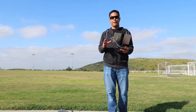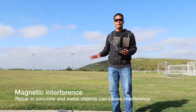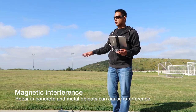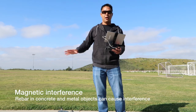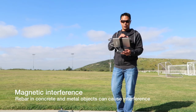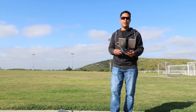If you're having trouble calibrating your compass on your Mavic, you might have magnetic interference nearby, or it may just have been a bad calibration attempt. Move to a different location — it could be in a grass area or another part of the sidewalk. Once it's calibrated, you'll see the green flashing lights and the app will show it's ready to go in GPS mode. That means you're all ready for takeoff.